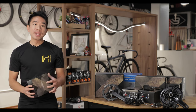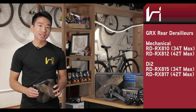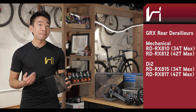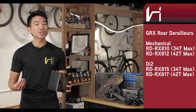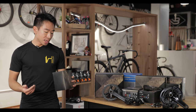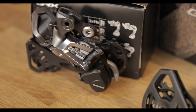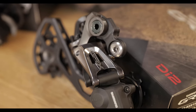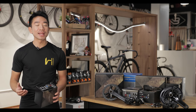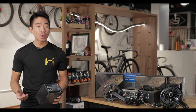You have two part numbers for the DI2: 815 and 817. The difference between them is maximum rear cassette capacity. On the 815 you can use a maximum 34-tooth cassette, whereas on the 817 you can use a maximum of 42. Now officially according to Shimano the 817 is meant for a 1x11 drivetrain — if you want a 2x you go with the 815. Unofficially at Velaholic Cycles what we've discovered is that the 817 actually works with a 2x as well. One small caveat: if you're using the front smaller chainring, the last three cogs on your cassette will be electronically locked out and not accessible. That is the only downside of using an 817 with a 2x drivetrain.